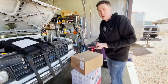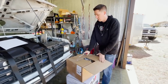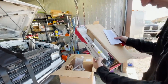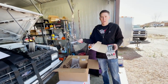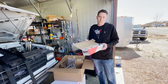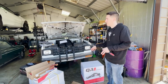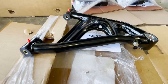My plan is to click this thing all the way tight, get a really stiff suspension, see what type of burnouts it does, and adjust from there. The rear shocks are double adjustable so we can play with compression and rebound. If we want it somewhat loose we have that adjustability too. These are some of the suspension arms — the upper and lower. It's a 350 truck to begin with and it's getting well more than that worth of A-arms. This must be the coilovers for the front — wow, that's a big spring!